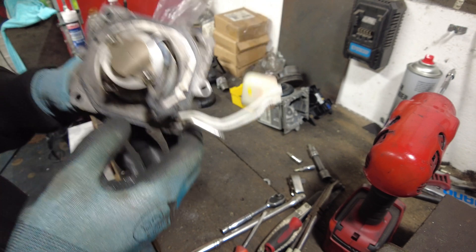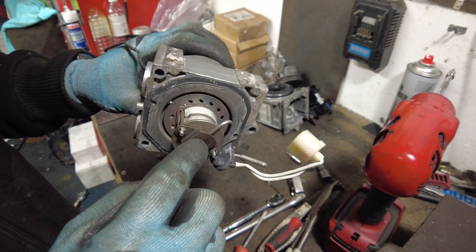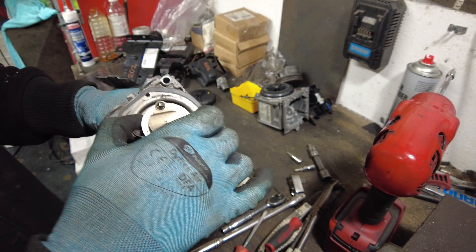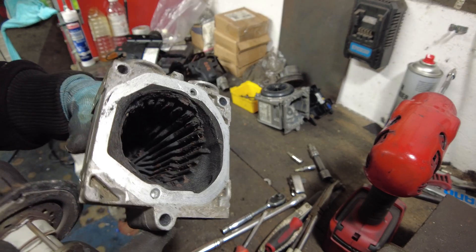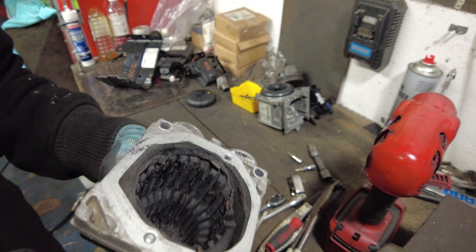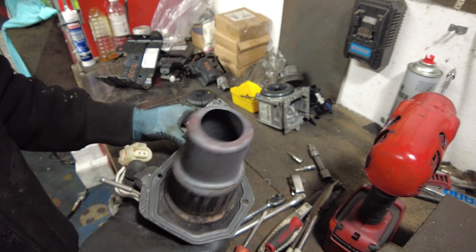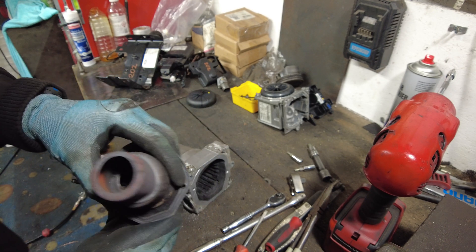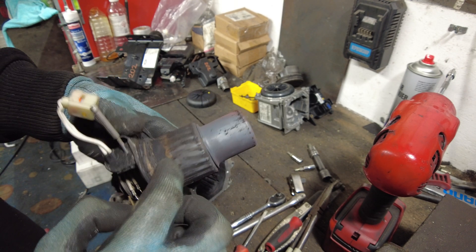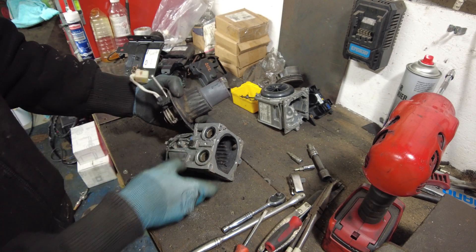Here is the burner part of it. This wire goes to the glow plug just here. Fuel comes in round the other side and in through the top, and then you can lift this out. That's the combustion chamber and burn tube — it burns the fuel right down here and heats up the coolant that's running through this water jacket inside here.